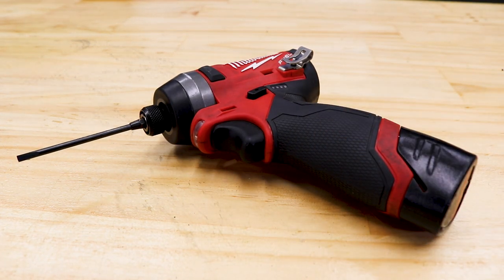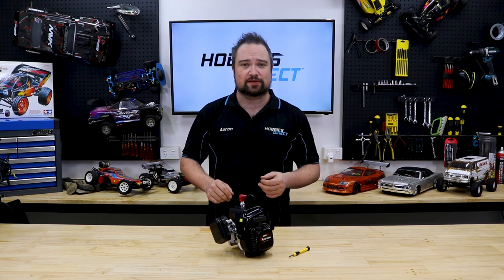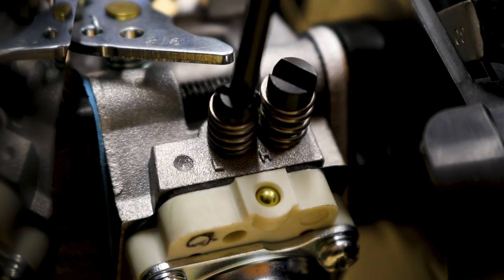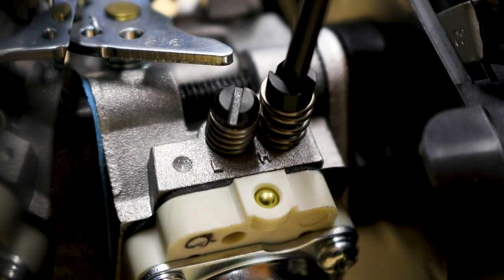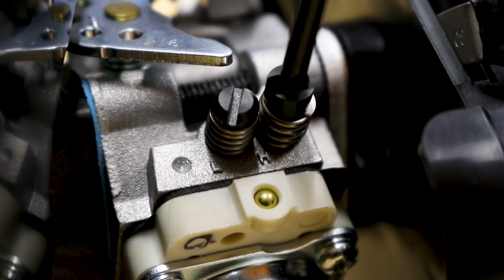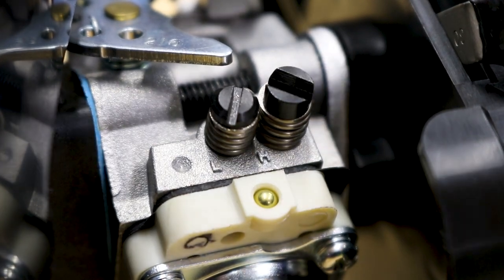This is one of very few occasions where I'm not going to use an electric screwdriver — so sorry buddy, next time. To get your carburetor back to a factory baseline tune, follow these steps. Firstly, we want to firmly wind the needles in. Be careful not to over-tighten them as this can damage the needles. You aren't tightening a screw here, so go gently. You'll be able to feel when the needle is all the way in.